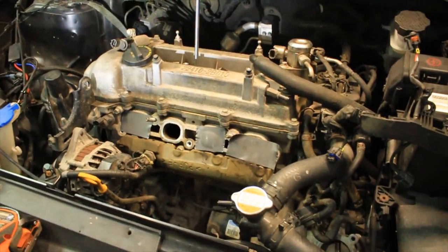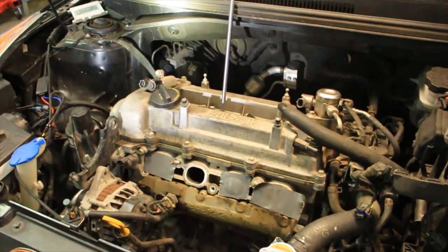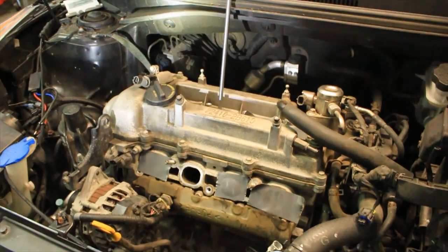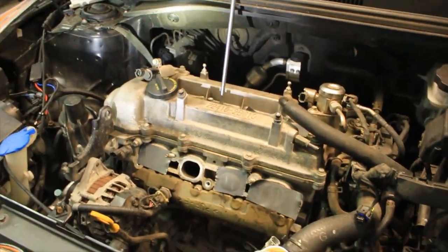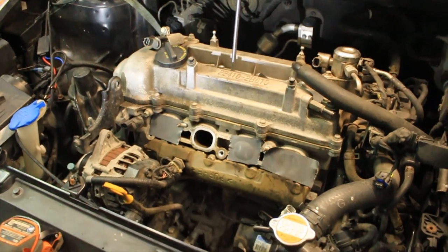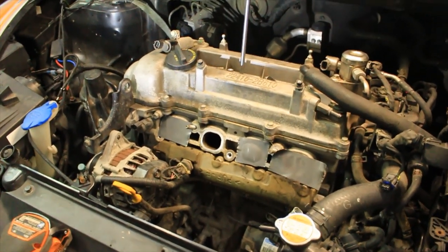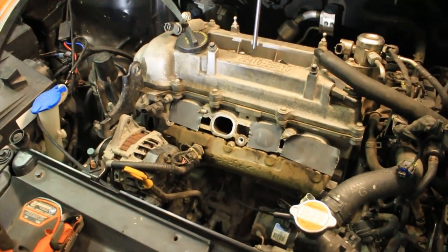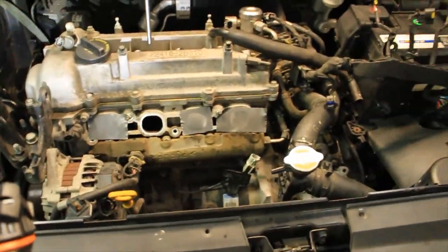Those of us who want to own the car long-term are gonna have to deal with this stuff. Toyota is one of my favorites - they went ahead and did direct and port injection to wash the intake valves, and those engines don't have any carbon problems. They've done quality control checks pulling heads after 60K and there's not a speck of carbon on the valves.